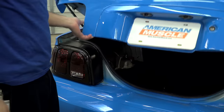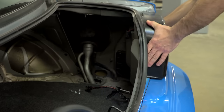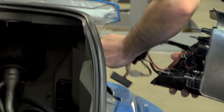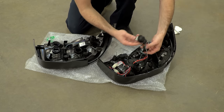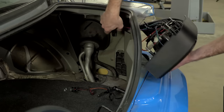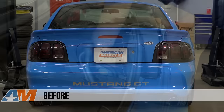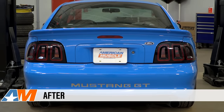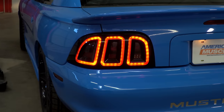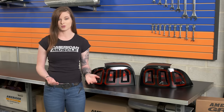For the install, all you have to do is remove the trunk insulation by pulling the retaining clip so you can have access to the four nuts that are holding the tail light into place. Once the nuts are removed, you can pull the light assembly away from the car. You remove the bulbs by just twisting them, and since you're going to install the tail lights with the factory bulbs, we're going to leave them in the car. After that, it's as simple as locking the bulbs into the new housings, plugging in the LED harness, and placing the housings back into the car. Be sure to test these out before you take off — make sure they light up as they're supposed to and the turn signals work as well.